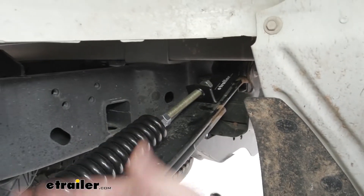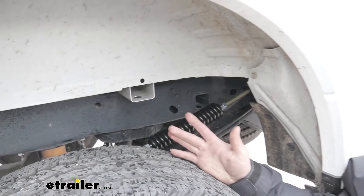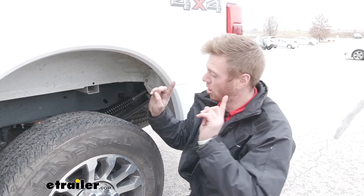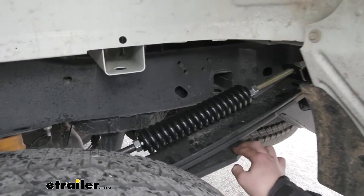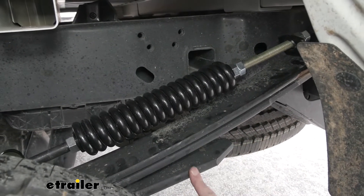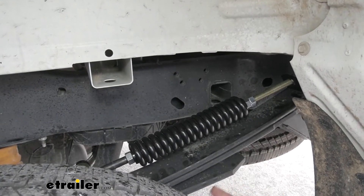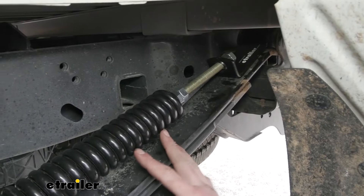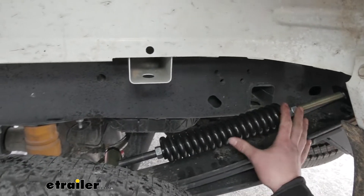This add-on component isn't going to require us to take any of the factory equipment off, which I really like. You buy a new truck, you want a little bit more help with the suspension, you don't have to remove anything that's already there. Adding another component to take some of that load is going to put less strain on your existing components. If three leaf springs are handling 5,000 pounds, now with a fourth component it can be divided by four instead of three - it's going to prolong life, prevent axle wrapping, and prevent bottoming out. This is going to be a lot less maintenance than typical airbags, and just like airbags we can adjust it.